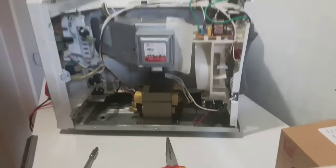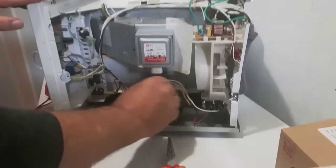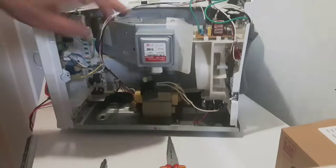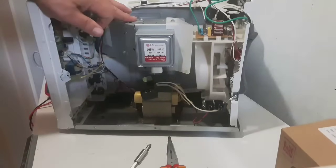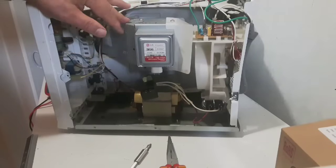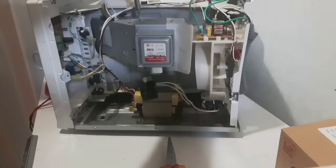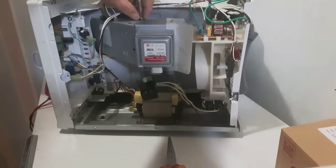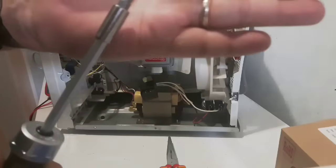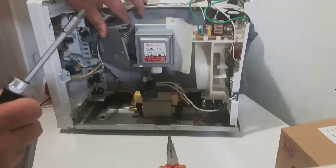Anyway, we're going to look at the microwave today. We've discharged it and disconnected it at the bottom — there's a connector here. I'm going to disconnect this and take the microwave apart, the magnetron apart. I need a Phillips screwdriver. There's actually five screws holding this magnetron in, all Phillips. One has a different thread on it — I'll show you in a second. This is the light that holds on the piece here, so that's a self-tapping one. That light comes off; there are four screws in here.